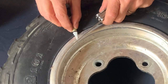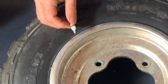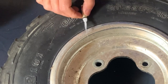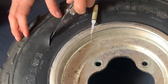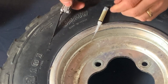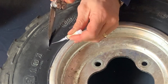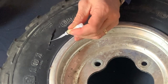You've got to start the process by cutting the tip off the adhesive so you can get it to flow. You can see a little bit came out there. Then put on the applicator tip. You need the applicator tip because you want to put small drops of adhesive on the edge of this cut. You may want to practice a little bit and make sure these edges are going to fold in right. Just put some drops down through here — you don't want to do too much.